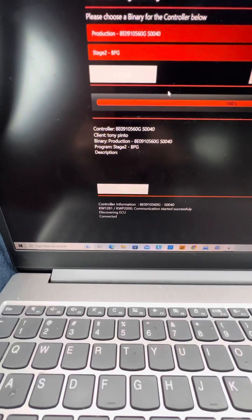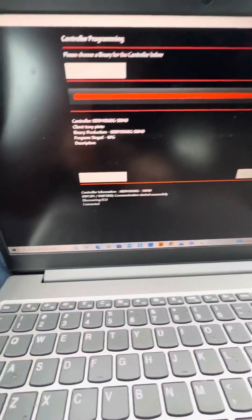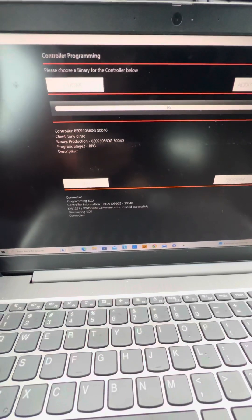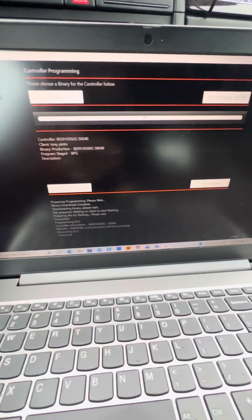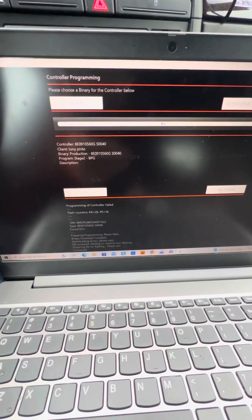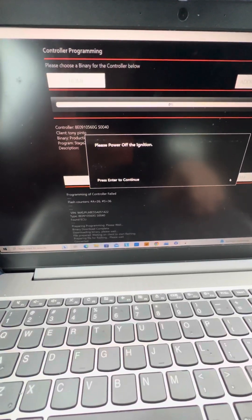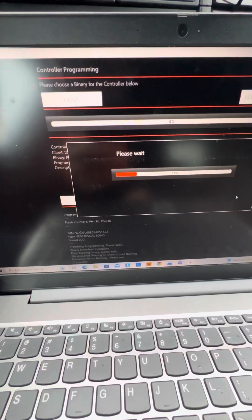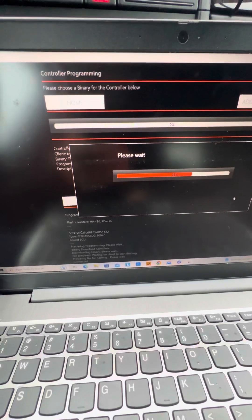It's going to show you down here exactly what you're going to install, so come over here and hit Confirm. Double check what you're going to flash, then hit Program — and that's it, it's going to flash your ECU. This one was already flashed so it was very quick. Once it is done it will prompt you to turn the key off. Hit Enter, turn the key back on, hit Enter — power off the ignition, hit Enter, and it's going to tell you to turn the ignition back on and then back off. Then you are free to start your vehicle.